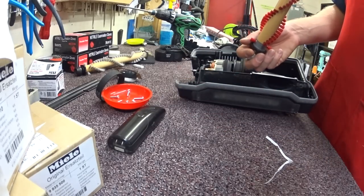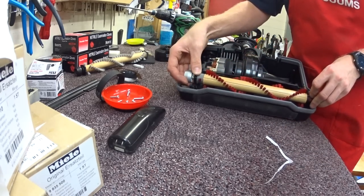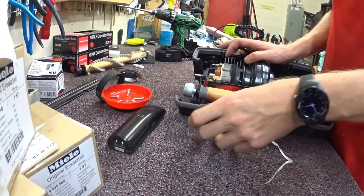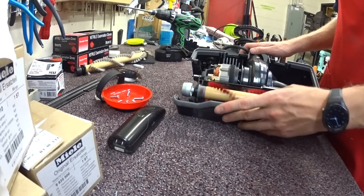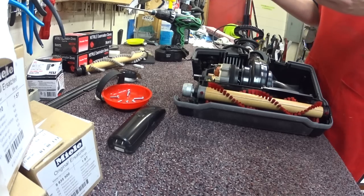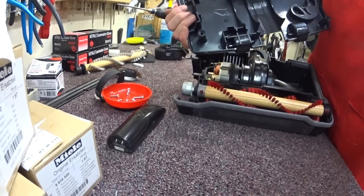Back to this several hours later. No wiggle. If this does wiggle, you can shim it with a zip tie, but it's rarer for an XL21 to wiggle — that's more of a classic issue. So we're going to put the cover back on. If this gasket here is chewed up, of course you're going to replace it.